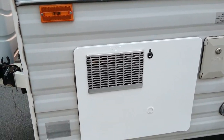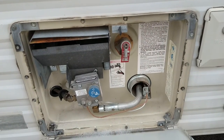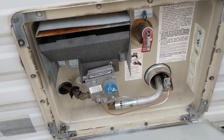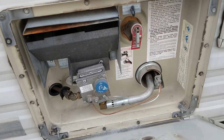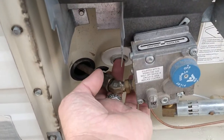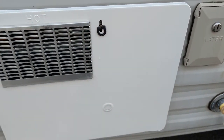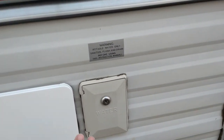Here's your water heater — it's an Atwood 6-gallon, pretty standard stuff. The Atwood doesn't require an anode rod because it uses an aluminum tank. Your Suburban water heater does require one because it has a steel tank — the anode rod goes right in here. It's a sacrificial anode rod: the minerals in hard water will attack that before they attack and destroy your steel tank.